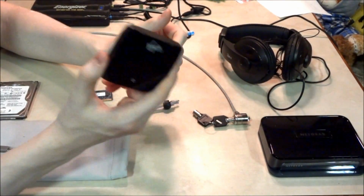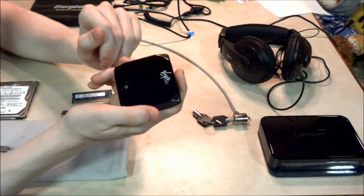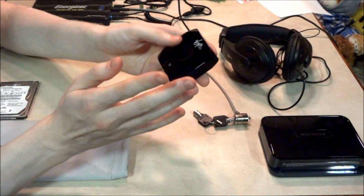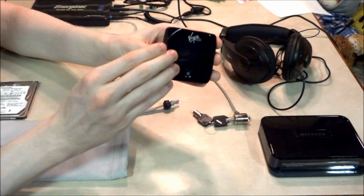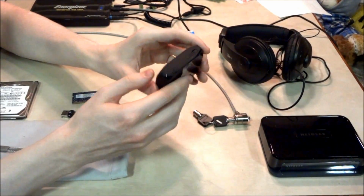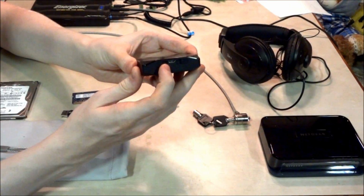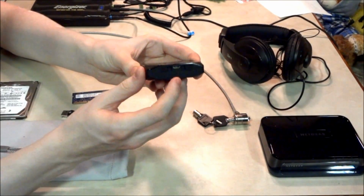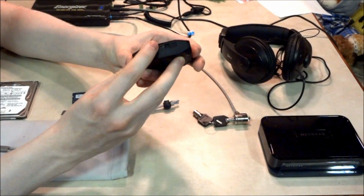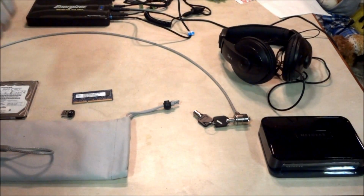There are some extras with a mobile hotspot like this. For instance, there is a micro SD card slot on it, so this will also function as a network storage interface. So you can put a micro SD card in there, and any computers or tablets that can connect to this can see that micro SD card as a network storage drive, so you can send and receive files off of that. You can also tether your computer to it via USB, so if you want to tether directly to this over a USB connection, you just connect it to the bottom. And also with this, there's actually a 3G and 4G antenna port, so you can connect up an external 3G or 4G antenna if you want to boost the signal of this. Putting that aside,